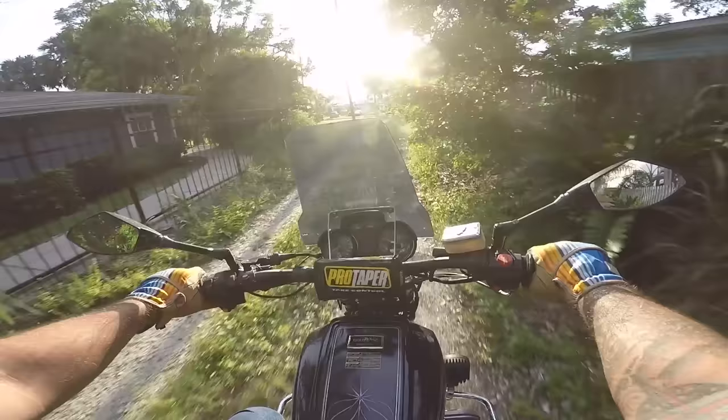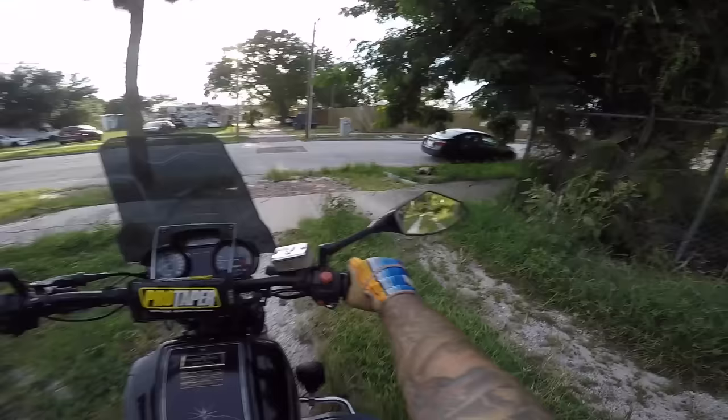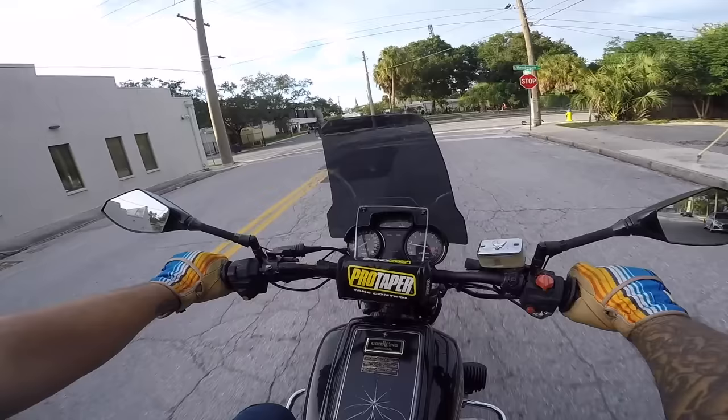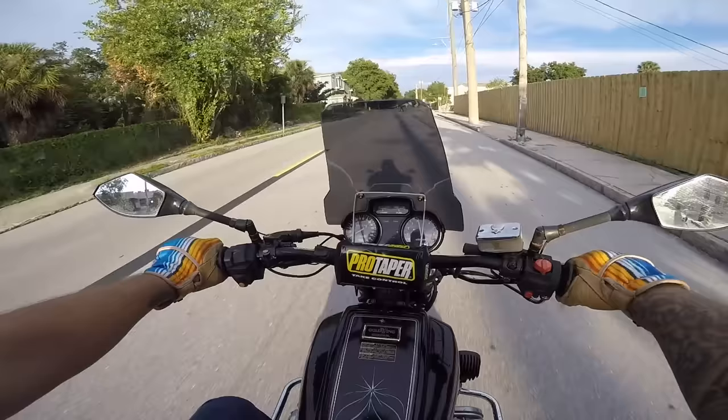All right, look at that, we have pointed the Goldwing off-road and we are now off-road. Is it doing any better than it would have normally? Yeah, definitely better than it would have before, because before it had a couple of absolutely blown out air shocks, so anything was going to be an improvement over that. But seeing as these 80s Goldwings have 39 millimeter Showas on them, and Sportsters come with 39 millimeter Showas on them, I just said, well, why wouldn't they fit in there?